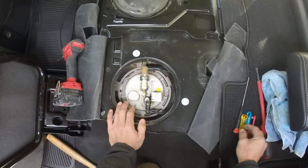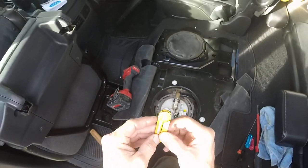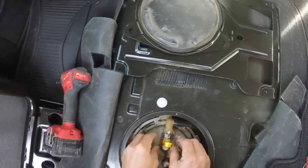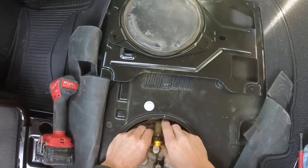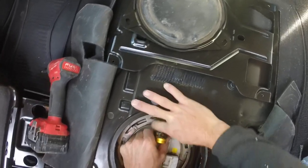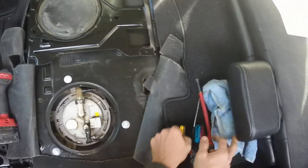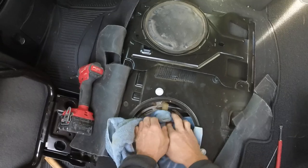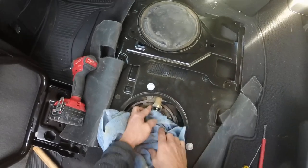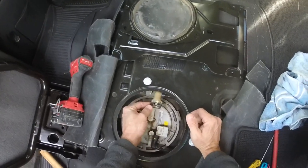Next tool — I bought these over at AutoZone, they do make things easier. Put that on there — it pops forward so it unclips the fitting, then you kind of walk it back. Just in case there's fuel in there, because I believe that's the return line. Pops that out. This one's always a pain to keep out of the way, but you just got to make it work.